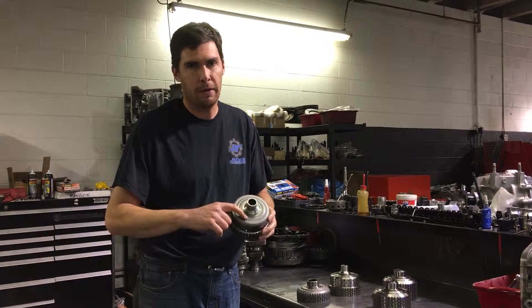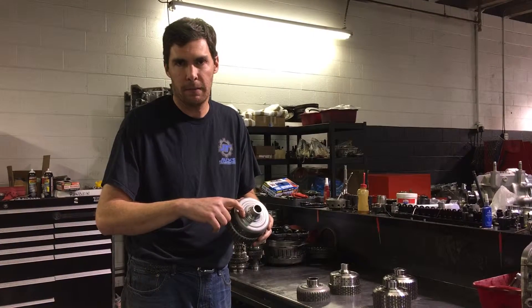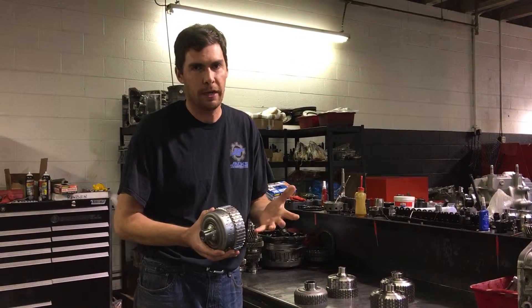So we go through it again with another laser welder we have available, and also just shy of the weld it can fatigue and break as well, so we actually stress relieve this area to try to get as much out of these baskets as we can.